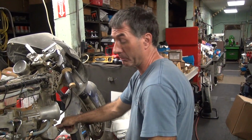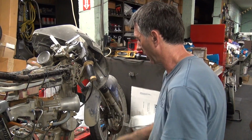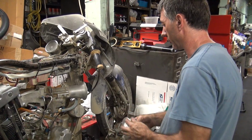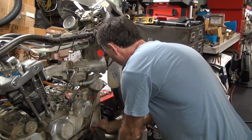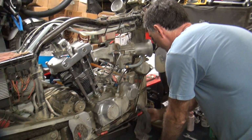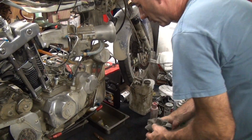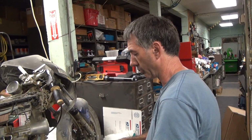Well, we didn't see any more wear on the piston at least. That's a plus. That had a maximum of 50 weight. I had it when I seized the piston, but that's good oil too. I'm not blaming that on the piston or the oil. When you run an unknown combination, you're putting a lot of raw fuel in the motor, and it pretty much fuel washes the whole motor out.